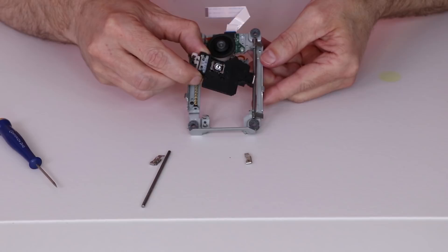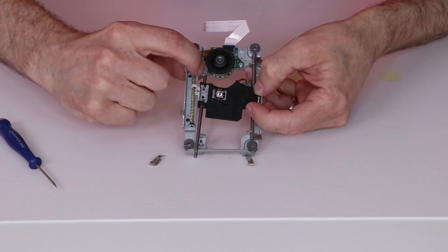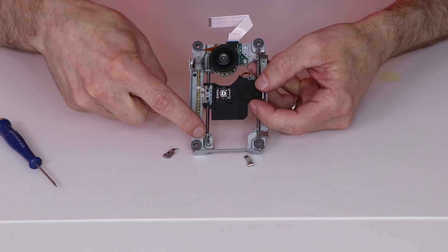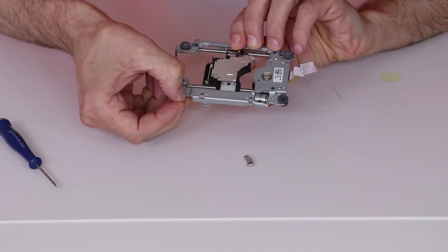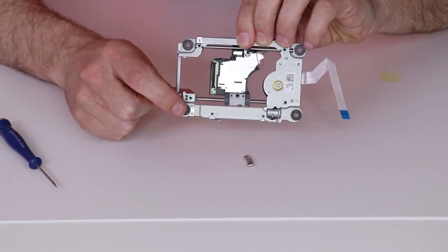Once you have the new laser, install it back onto the bar first, then take the bar and install it back on as well. The bar needs to go through the hole in this piece, then keep sliding the bar back, make sure the white piece is installed correctly over the worm gear, then push the bar back under this metal piece and all the way back until fully installed. Now we just need to put the clips back on — orient them over the two dimples and slide them on with your finger until they click in.